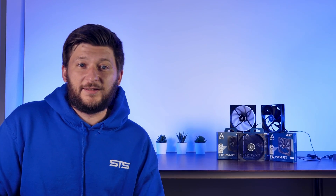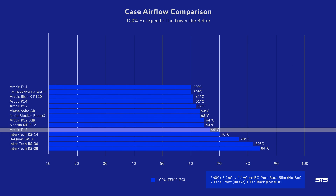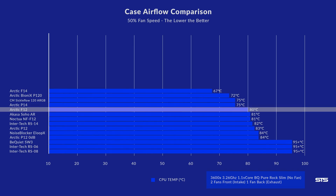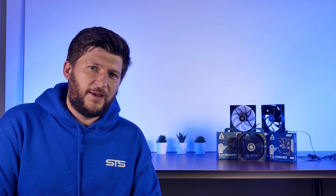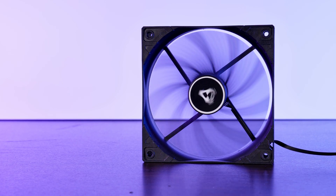That being said, in the end it's the absolute performance that counts. So we did multiple benchmarks to see if — and at what point — an F12 may be better suited than a P12. First up was our usual benchmark inside the Acer Hive case with two F12s in the front and one in the back as exhaust, and a be quiet! Pure Rock Slim without any fans, to maximize the fan benefit. At 100% fan speed the F12s kept the Ryzen 5 3600X at 66°C — perfectly fitting our expectations, a bit less than a P12 at lower static pressure, which makes sense. At 50% fan speed this changed: the F12s kept the 3600X at 80°C, three degrees lower than a P12. My best guess is that the amount of air in relation to fan speed is not a flat line but more like a curve, letting the F12's efficiency kick in and push more air than a P12 at 50% fan speed.